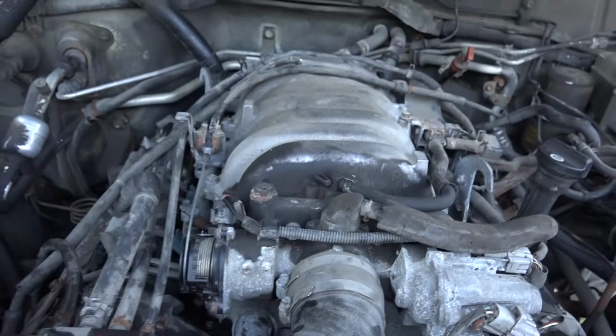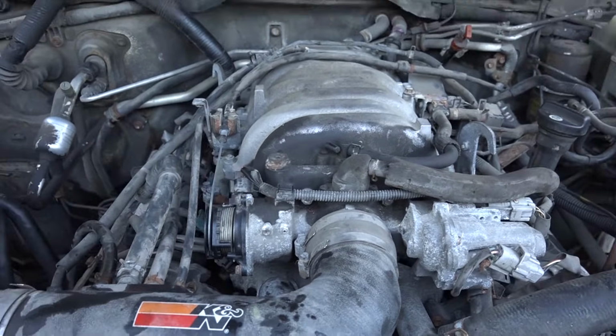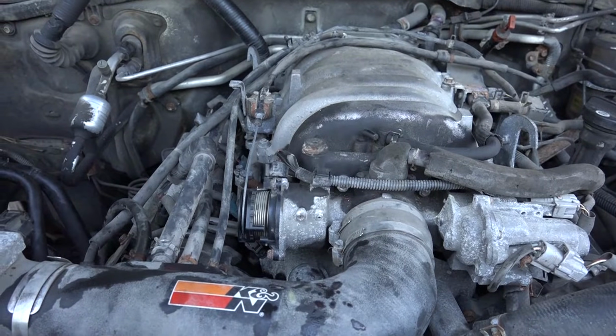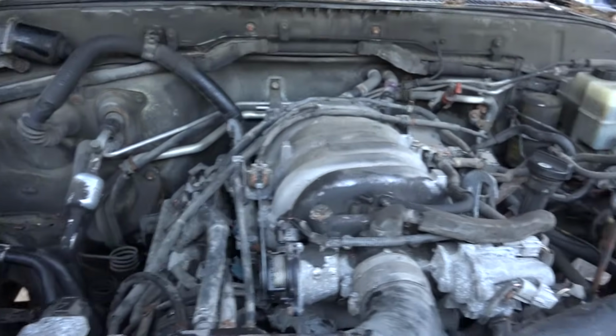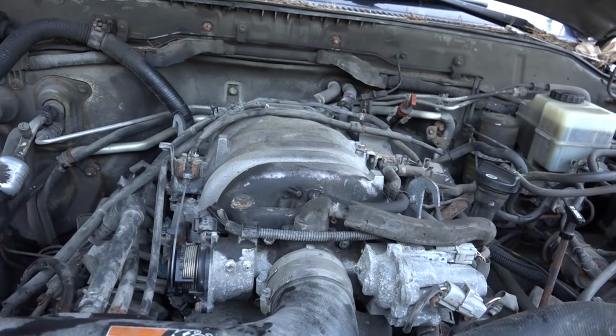I broke it, but I think it'll be fine. I wedged it on real good, and I put a bit of silicone, so that should be fine. The two harder lower bolts at the back on the starter that are 14 mil, either just use a plain deep socket, or I didn't try, but I think even just a regular socket might be fine.